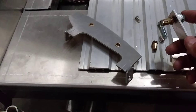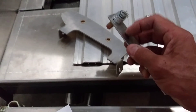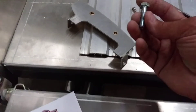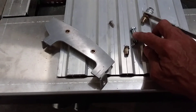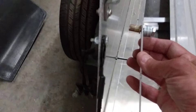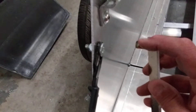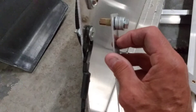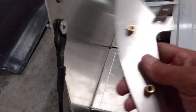So we decided you could have the option of using these rivnuts. And here's the trick if you don't have a rivnut tool — here's how you set it up. Take a piece of scrap aluminum and drill your eight millimeter or five-sixteenths inch hole in this little scrap plate. In the kit we give you these hex head grade fives that are used to mount the aluminum to the fender. Before you mount that, use the same bolts to make a little mini rivnutter. I put a stack of washers on here to cover the smooth shank. Basically, you're going to put this rivnut in the hole that you drill — the hole for the big rivnut is 27/64ths — and the tightening of that bolt will pull the rivnut tight and give you this kind of a finished part.